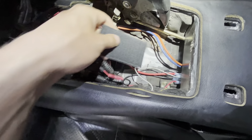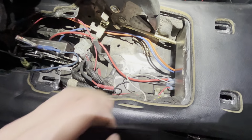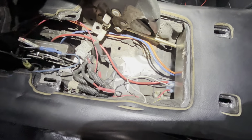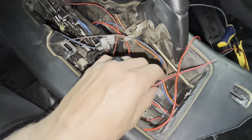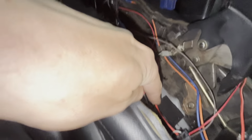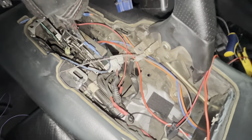So we're putting it right there. I cleaned a good area, so I'm going to put a Velcro square down in there. That way, if I need to remove the sensor for any reason, I can. I was going to do a bolt down through the center, but we're going to Velcro it — if the Velcro for some reason doesn't hold, then I'll do a bolt. Right now we're getting our wires situated. We have our ground and our power, and we're currently running the sensor wire. The wires are going to be hidden, coming across from the ECU, under here. Sensor will sit down in there.